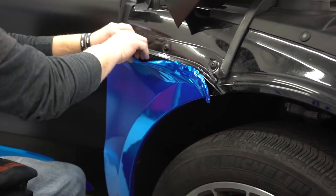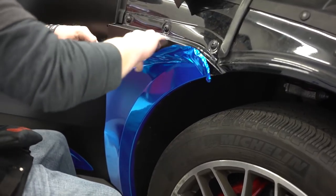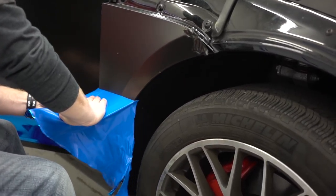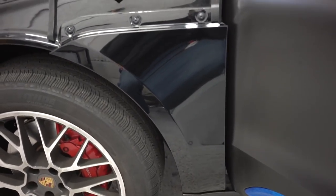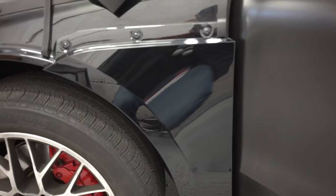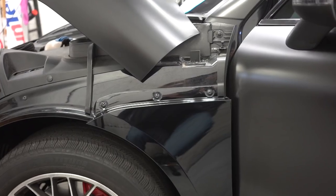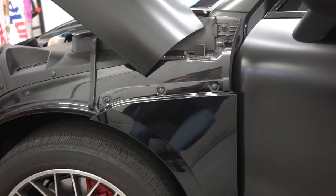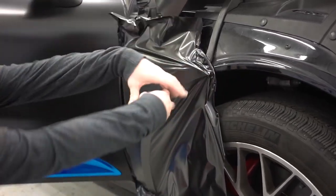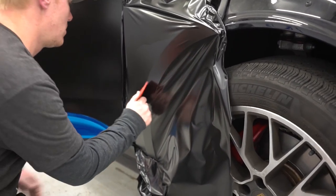If it's post-heated correctly then it's not going to want to come off without heating it up a little. It's only going to be like this for a couple minutes, but you guys can tell the difference — the satin black here doesn't have much of a shine compared to the original color of the car. When it shrinks it's not going to curl up, it's going to get tighter. That's the trick to corners, it's very hard to master.